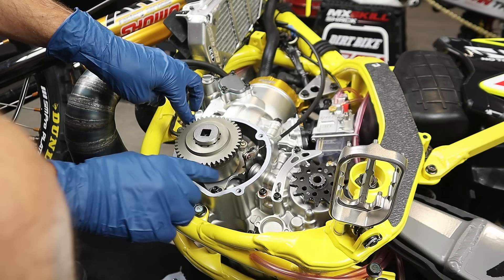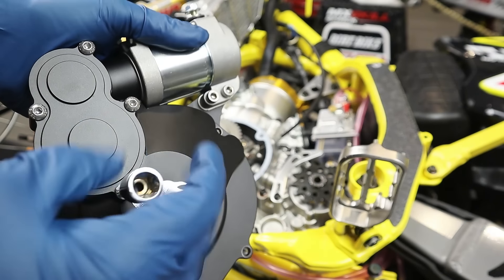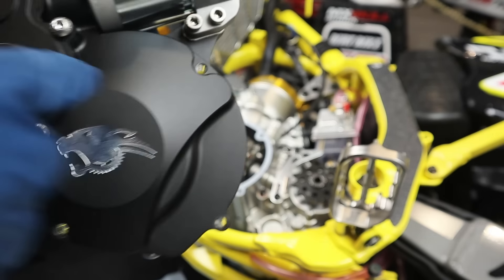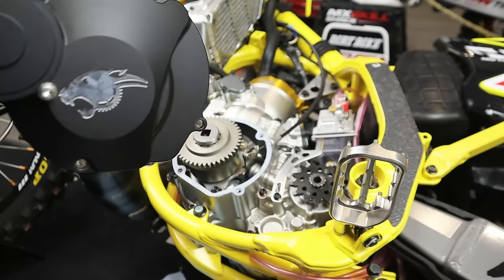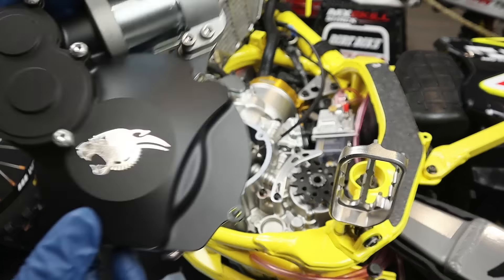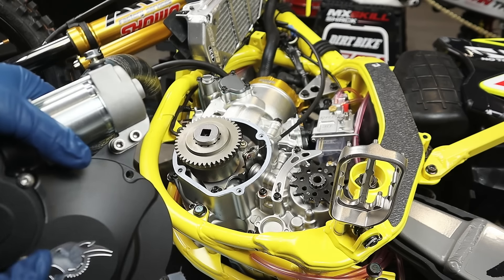Next steps: remove this cover from the Panthera e-start housing, which reveals a couple of gears and another gasket. We need to get those out of the way to access the fourth mounting hole that allows us to mount it to the engine. There are some witness marks on there from my dry run, just to make sure everything was going to fit properly. There are depth specifications for how far the gear should or should not be out when you're done tightening — those are in the directions, so be mindful of those.